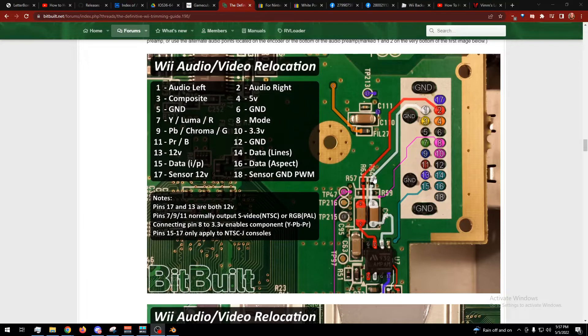I used the this side of these capacitors and just ran those out. The only thing that bypasses is these resistors here, which are current limiting — not strictly necessary, but it's protection in case you get a broken cable or a receiver that tries to draw too much current. These capacitors here would do a lot to limit that anyway since they're AC coupling capacitors in-line. So I wouldn't go straight to the chip — go on the other side of these resistors. They're just tiny and easier to solder to.